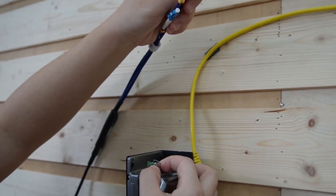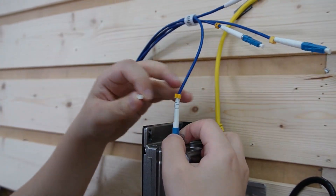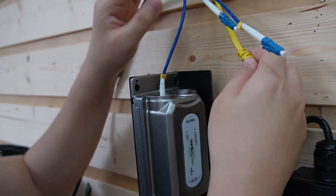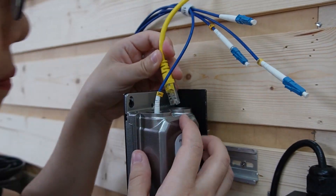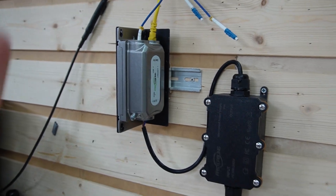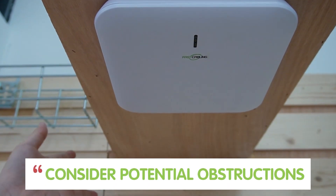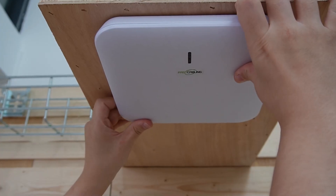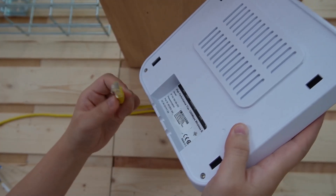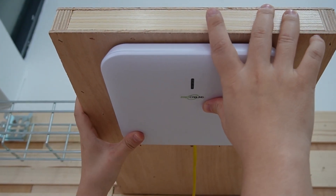Remember, we use strand A — this one here. Slide it in — you should be able to hear the click sound. Here we are going to use the ethernet cable to connect with our access point. Just plug it in. We can place the access point in an optimal location for maximum coverage. Today we are using the ceiling mounting technique. You should consider potential obstructions — it can be ceiling-mounted or wall-mounted as well. The access point can be powered by DC or PoE, and today we are using Power over Ethernet. Connect it to the access point and plug it back in.